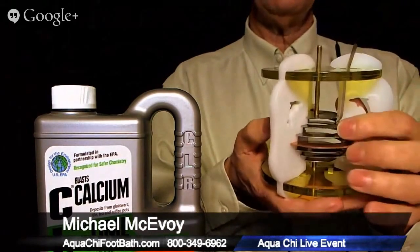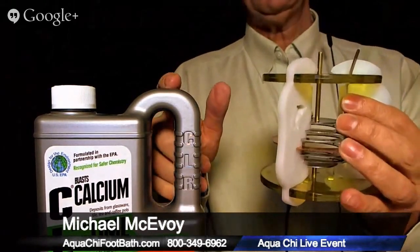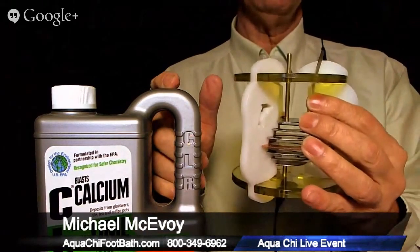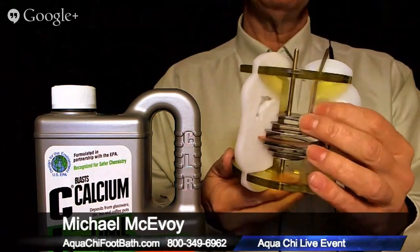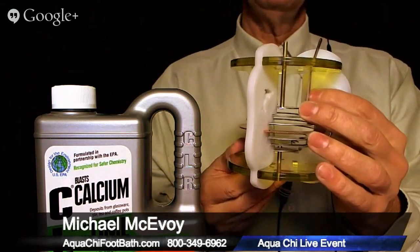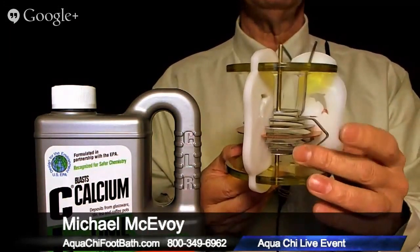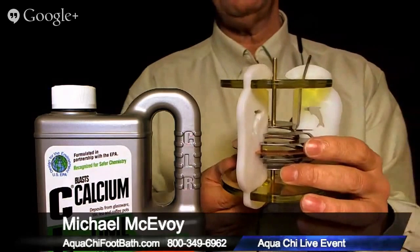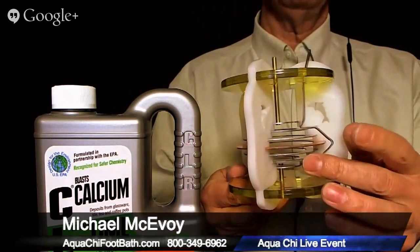The key here is that we're recommending full strength instead of diluted, because it will do a better job of cleaning your module. Now, what you need to do after each bath is to soak your module in that CLR solution for, I would say, a half hour to 40 minutes is a good middle ground. Some people could be shorter, some people longer, but that's a good rule of thumb.